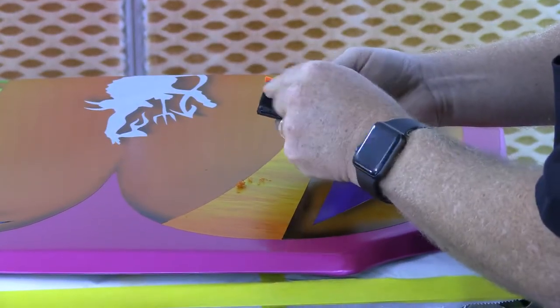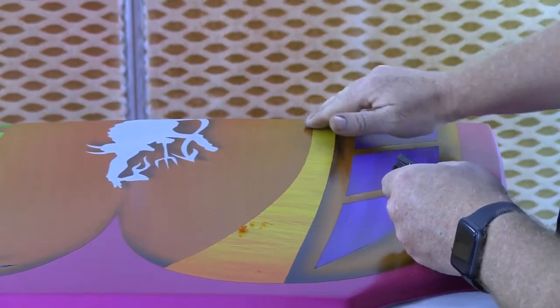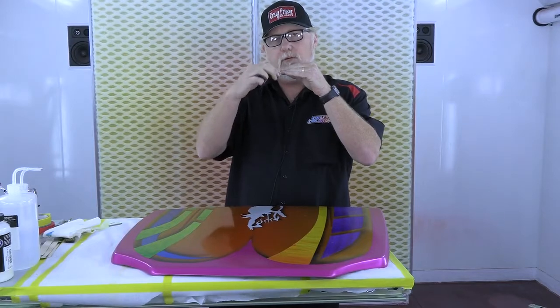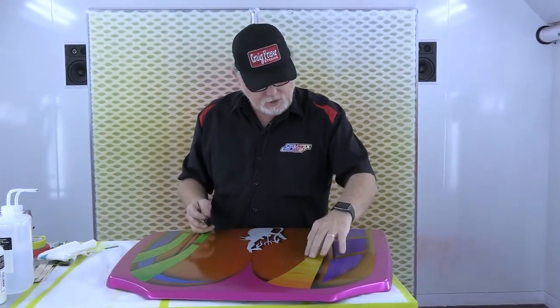And it's got a little padded surface on the bottom. Every now and then you want to clean that to make sure it doesn't grab any metallics. But it works really nice. That right there is a good enough edge to pinstripe, and you won't have any peeking. The peeking is the problem, where it'll peek through, and then if you're sanding and buffing later on, if there's a peek under that pinstripe edge, all of a sudden it looks like you have two pinstripes, with a little color in between, that paint coming through. Major, major pain in the butt. And right there, it safely removes that edge without nicking, damaging, scuffing or scratching either side.